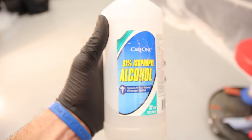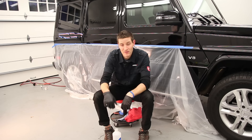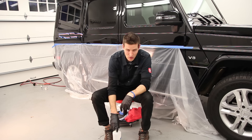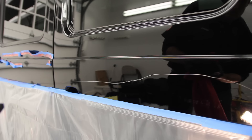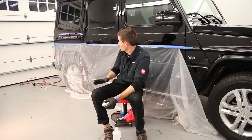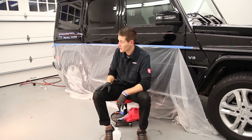The next step is to clean with 91% isopropanol. I envision this like getting a cut on your skin — the first thing you want to do is clean it out. You're going to take all the oils and gunk out of it so that all of our new materials can stick to it, like Bondo. I also debated with Richard whether to wet sand first. You can hear how deep it is — any chance of wet sanding it out is not really an option. When a key mark is jagged, there are little spikes sticking up. You can feel that by running your hand across it; your glove will catch a little bit and you can almost hear it.